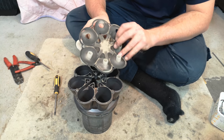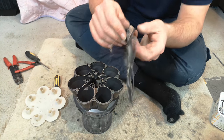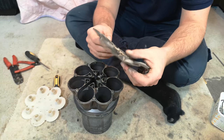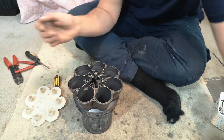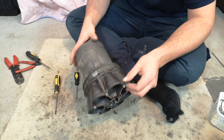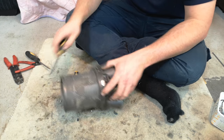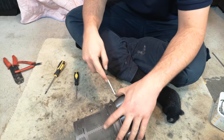Right, this is the first replacement part that we actually need for this machine, which is the cyclone gasket. Years of use literally wear the rubber foam away. And again, they're quite cheap. I shall go and order one shortly. So that is also fit for the rubbish. This needs to be washed. Then we just need to split this, and there is the top of the bin seal there. And again, more chunky clips to pop off.